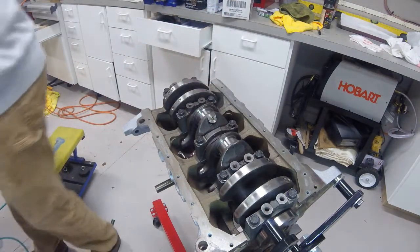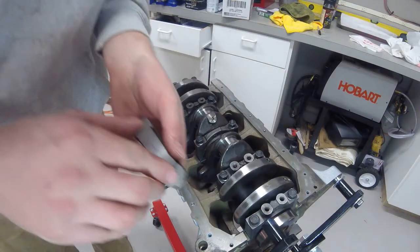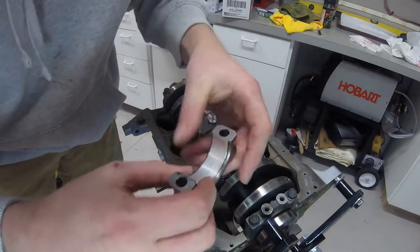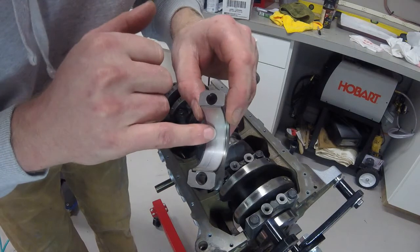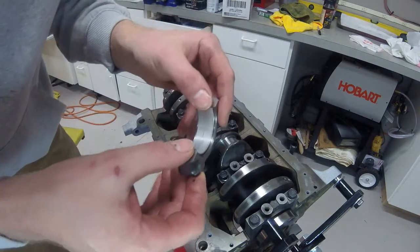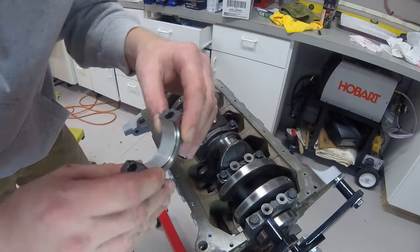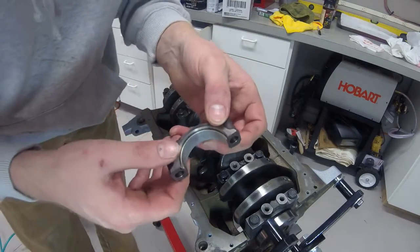Give that a quick blow to get all the lint off the bearing, then insert the tang the same way you always do and snap the bearing in until it feels nice and tight. Make sure it fits properly in that bearing surface. This is my one rod bearing that had a fair amount of scoring in it, but you can't even feel it with your fingernail. My machinist said the clearances were so well done and still tight that since I'm not looking to put a lot of miles on this motor before a real rebuild, just live with it — it should be good to go for quite a while.